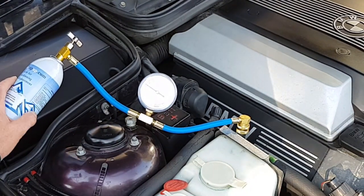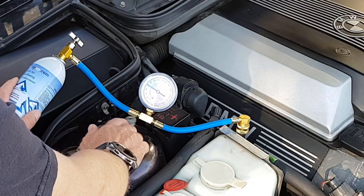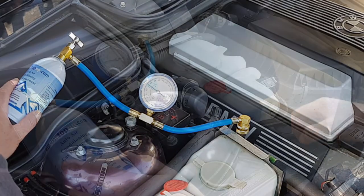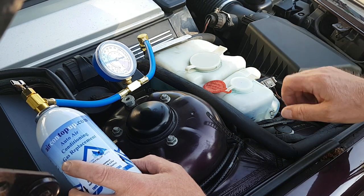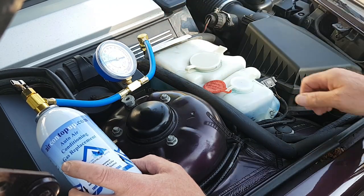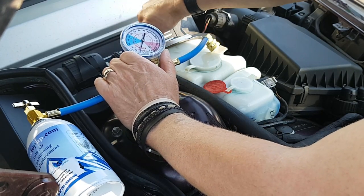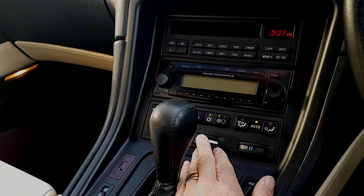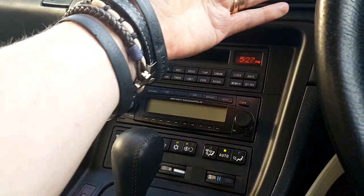I will warn you that some of these gauges are wildly inaccurate. I used an old gauge I'd had since the E32 days and it was miles out, whipping off the end of the scale. That usually means the compressor's had it and the system pressure is just high all around. As you saw when we started the engine and the compressor started moving, the pressure drops quite significantly. Back in the car - with the fan on full - the E31 air conditioning is absolutely fantastic, chucking out a lot of air.